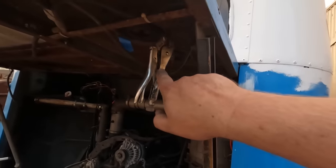Now that this stuff has dried thoroughly, let's see what it covers up. You can see a tiny gap there, but most of it's gone. Pits smaller than this one it did fill — obviously that's getting too big. It really pretty much filled most of it in. It's not a smooth glossy finish, but it's not too bad, and it hides a lot — so I'm pretty happy with this. It's real similar to the texture of the roof that was rollered on. I painted the back and one side of the bus with the first gallon, then moved to a new spot to do the front and the other side. I learned something important about this Durabac stuff — I painted over a lot of locks and I've always been able to shove a key in them and make them operate, but this stuff doesn't work the same. If you have locks or something, mask them off first. Something's turning — good enough. There's a lesson learned. Cut the lock cylinders apart and let them soak in a little puddle of brake fluid — seems to be cleaning that stuff off nicely.